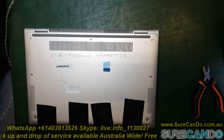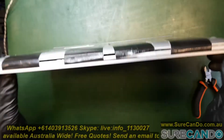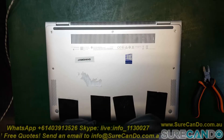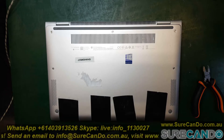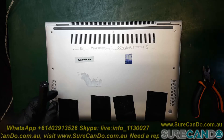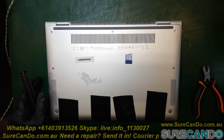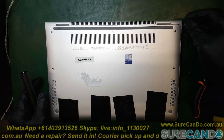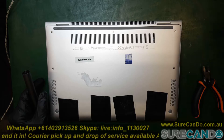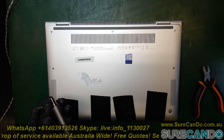This is a very quick video. It's an HP EliteBook X360 1030 G2. The user has taped this laptop thinking the case has a problem. In fact the battery has expanded and it's under a lot of pressure, and thanks to good sealing and packaging by the manufacturer it hasn't leaked or exploded. So we're going to remove the battery and install a new one, and I'll show you how you can remove the battery.